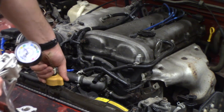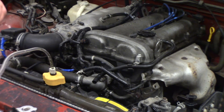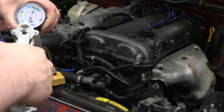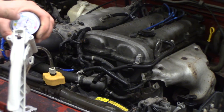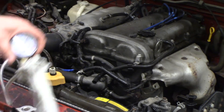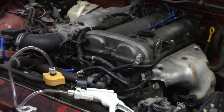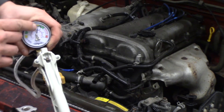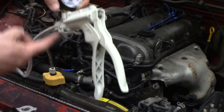Our cap wasn't sealing well at first — if you have that problem just move it around a little bit and it should seal up. We pump until we get to the yellow triangle at 16 psi. Then we set this down gently — being careful not to hit the vacuum release — and let it sit for a few minutes. Coming back: the gauge has dropped just a tiny bit below that triangle. I'd still call it good; there will be some minor leakage from the tester itself.